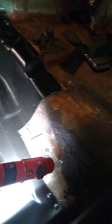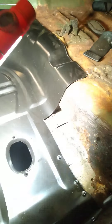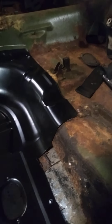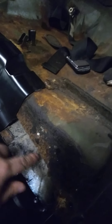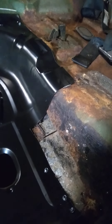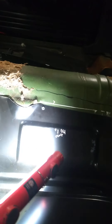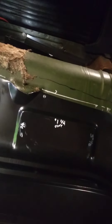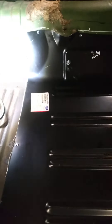Back here is your torque box — I'm going to trim some more of that metal away, not too much. It looks like someone patched it here a while back, but I'll probably take another half inch. I also want to coat inside of there with POR-15. If you look there, I got the measurements for the seat belt connector, which goes right here in the center. I gotta take that back out and spot weld that in, and I also put this in so it's pretty much tacked up.